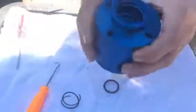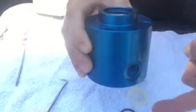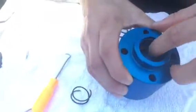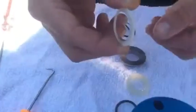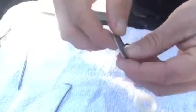I'm going to start with the top side. If you have your fluid cup like this once it's out, you'll have your 90 here, which can stay in there. We're going to do the top part first — it's very simple. You're going to put one of those brown O-rings flat down in there, and then the wiper. There's a lip; if you can see the lip, that lip needs to be faced down. Basically, the O-ring forms into that lip.